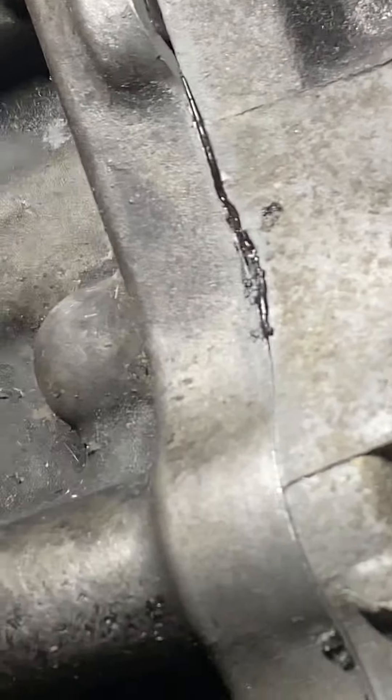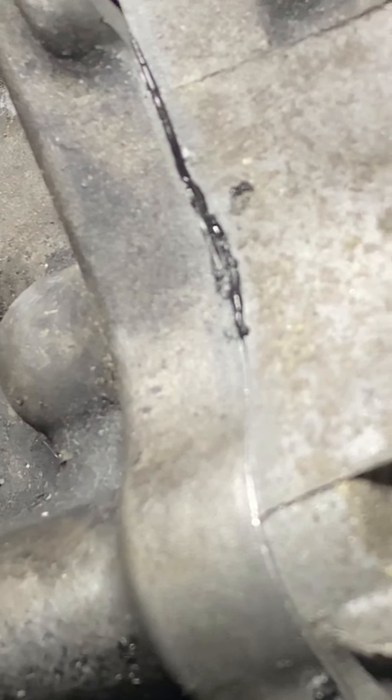If you look over here, it's just a little bit that comes out. Well, this is the water jacket — you're not going to get much sealant there because there's an O-ring. But all the way on the inside from back to front, you're completely sealed on the inside.